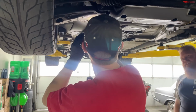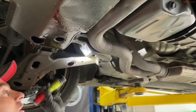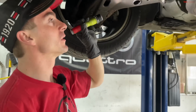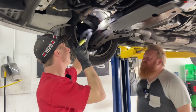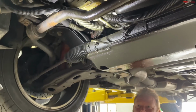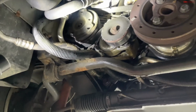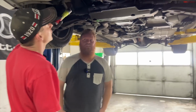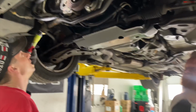And this side, I think, is getting a little bit of lubrication from the oil. It's a self-lubricating car, so it's just lubricating itself all the way. As you drive it, right? Long enough, you keep the oil leak the way it is, it's going to just start making the bushings decrepit, and they'll start ripping and fall apart into pieces. Lovely. Okay. Oil's real hard on a lot of the rubber stuff. Same with these rack boots. They're pretty oil soaked. So yeah, I think it's definitely going to need a belt too. You get a nice crack in the belt right there. Pretty big one. Yeah. Is that belt fairly easy to change out? Yeah, that one shouldn't be the end of the world though. Should be pretty simple. Well, that's good. Yeah. And it looks like someone just put the new water pump assembly on there and a few other pieces on this thing. Looks like an electronic one.